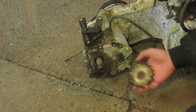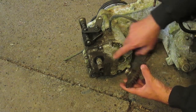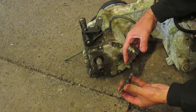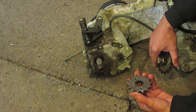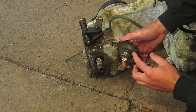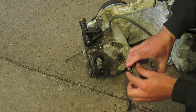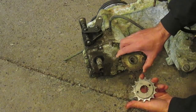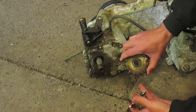I pulled the sprocket off and it has a weird spacer and seal lip for the gearbox — it's a really wide sprocket. Here's the sprocket from an XR650L; this one is about one and a half times wider. I'm going to go to a 520 chain pitch and cut this spacer ring and dust shield lip off, then weld the XR650 sprocket on there instead. Going from a 17 down to a 14 tooth should really help the gear ratio and low-end torque — I'm not expecting to go 45 anymore; if it tops out at 25, I'd be fine.